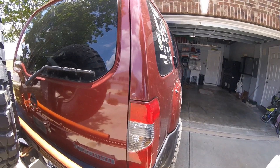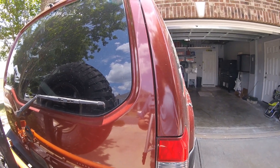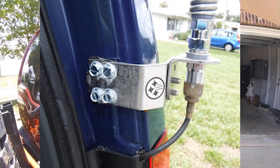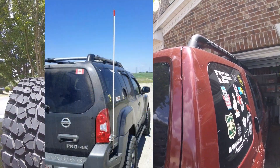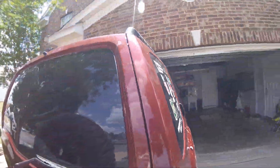Another option is a tail light mount, similar to the hood channel on the front fender area. You can get mounts designed to go into the seam, and the higher up you mount them, the more clearance you'll get with the tip of the antenna over the roof line and the better signal you'll get. But it's always a trade off — the taller your antenna is, the better reception and transmission you'll have, but it will be more susceptible to trail damage.